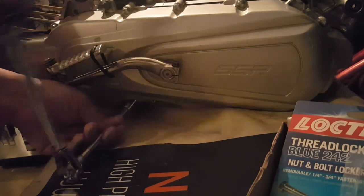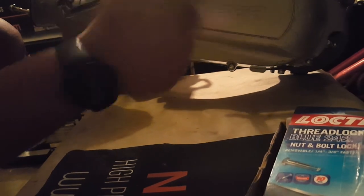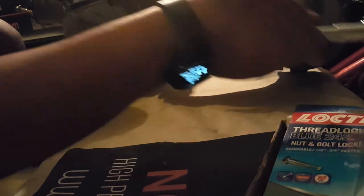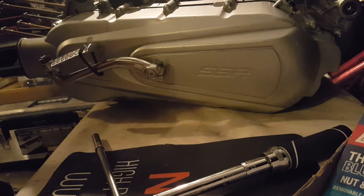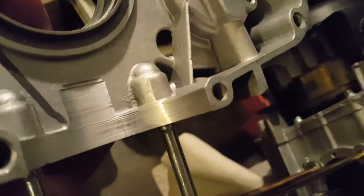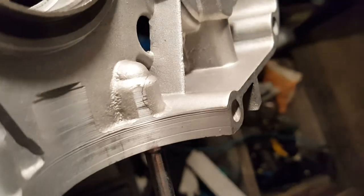Just going backwards a step, but it's good to see within 24 hours how the blue loctite held up. We also put blue loctite on our clutch nut as well as our variator nut, which we might have to take the variator off as well in order to get to the belt. These are aluminum so be really careful not to over-tighten. I want to show you what happens with the stud that I over-tightened. You should definitely follow the torque specs — for these studs it should be about seven pounds. This is what happens when you over-tighten your stud — you see that right there? I cranked this with all my might using the stud remover and didn't realize the damage it caused.